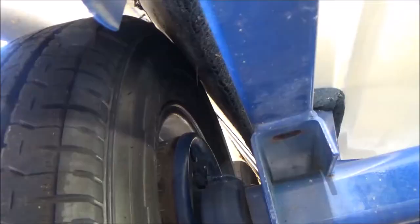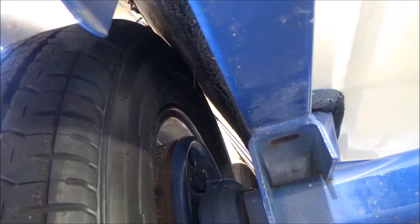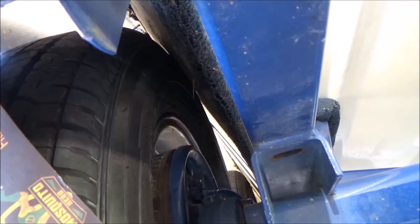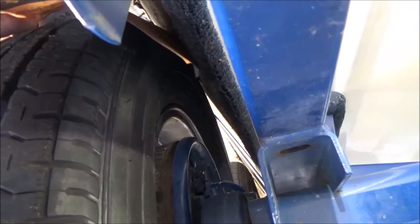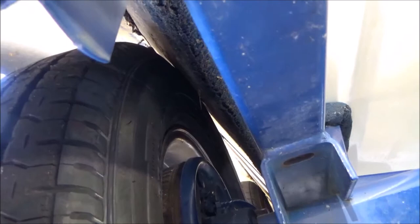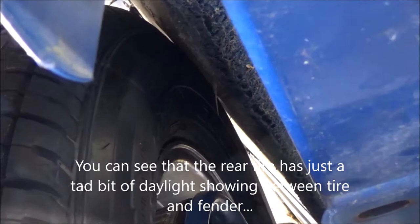Okay, so I am underneath the right front of the trailer. Towed this back about 3 weeks ago from Green Lake, Wisconsin. And the trailer tires were brand new from 1998. So obviously I had new tires on order since this is going to go. And I noticed that I can't get a piece of paper in here. I'm hitting right there, just sitting here with the load of the boat, that trailer tire is making contact and rubbing the inside of the fender well.